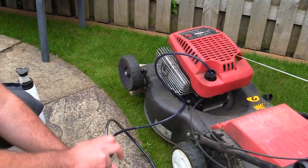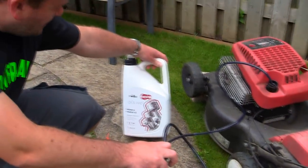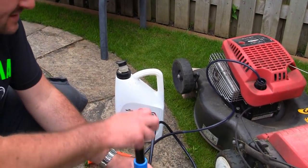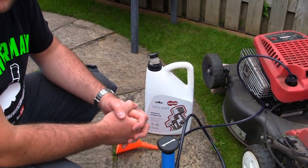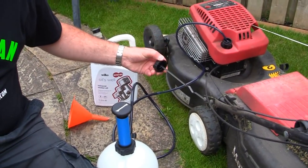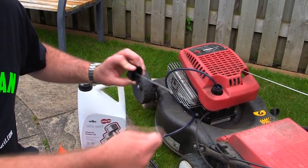Let's give this a couple more goes to make sure absolutely everything's out. If you haven't got anything specific, just get some standard motor oil — this is from Wilko's, about six pounds. As long as it's got some oil in it, it's going to run okay. Generally it's just half a litre of oil so I like to do just under that, tip it in manually and keep checking the gauge on the dipstick. We'll use the funnel and just take it up to about halfway on the notch and check the oil.